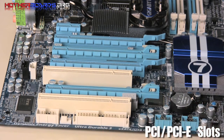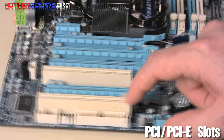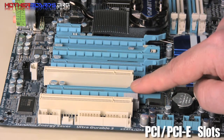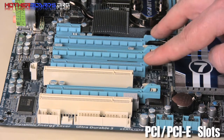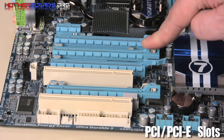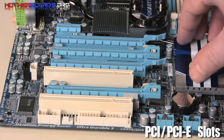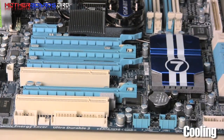You also get two USB 2.0 external connections here. Starting out, you get a standard PCI slot and another standard PCI slot. The bottom lane right here is a PCI-E 8-lane slot. Then you've got two lanes which are PCI-E x16, and this lane which is again PCI-E x8. As you can also see, there's a cooler over here that's cooling all the chips on the south side of the board to keep the board running cool.